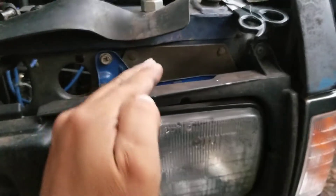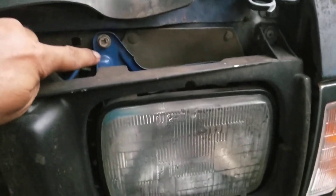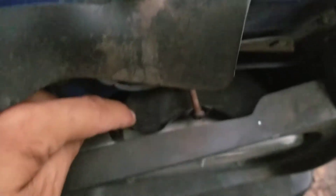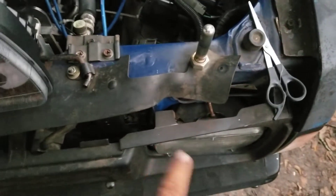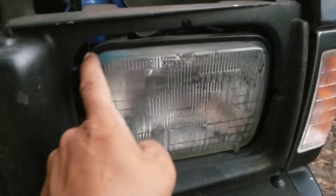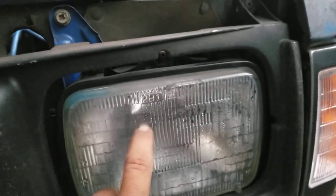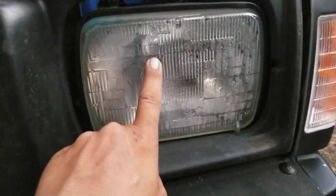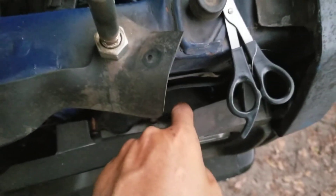This bracket — the cavity — there are two brackets: this main blue one over here and then this black one. I will have to trim those down in order to slide these into that spot and be able to bolt them down. The good part is this little trim right here is also what keeps the headlight in place — it bolts on to this rear bracket and this rear black one over here.